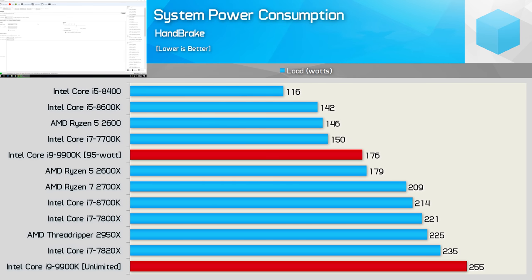These results explain a lot. Previously, we saw a few reviews that claimed the 9900K consumed less power than the 8700K, which doesn't really pass the common sense test. However, if you test the 9900K with a 95W TDP limit and leave the 8700K without one, you get that result. Even with the TDP limit in place, the 8700K and its 6 cores won't be impacted nearly as much as the 9900K and its 8 cores. For things to remain relatively even, the 9900K would need a TDP limit of at least 125 watts. What we see here is a 31% decrease in total system consumption as all 8 cores are wound down from 4.7GHz to 4GHz.